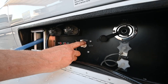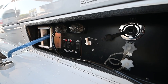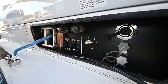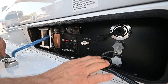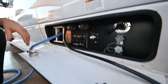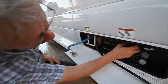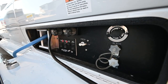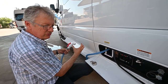If you overfill the fresh water tank by adding water to it, it's going to flow out on the ground. When done, go back to the city water position. If you want to run off the tank, just turn the pump on inside — that gives pressure on all the hot and cold lines inside the coach. Don't forget to shut off the valves and put the cap back on the city water since we're not hooked up. You'll need a water hose with a regulator, and if you want to adapt the sewer connection, you might need a small PVC adapter and a sealing donut.